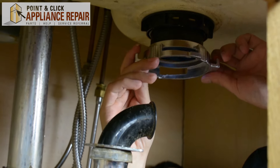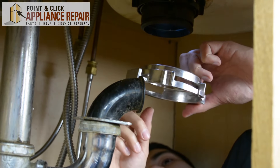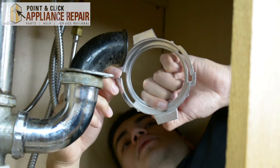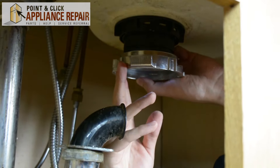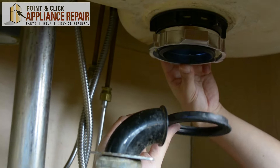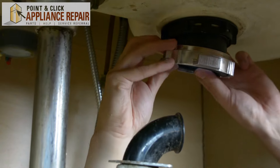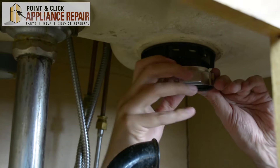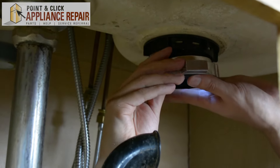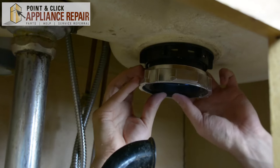Now we're putting this back up here, and you're going to want to make sure you put it on the right way. You'll know it's the right way because the bottom has this part that will connect onto your disposal. So you just put it right up in there, then we'll get our rubber gasket. Make sure you put it on the same way you took it off — this piece faces up with the widest part at the bottom. It might be a little bit difficult, you just have to kind of work it around as best as you can. But it will snap into place, just like that. Now you've got everything ready to put the disposal on.